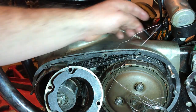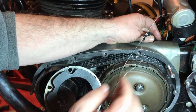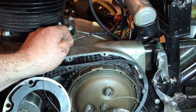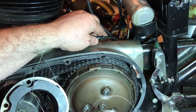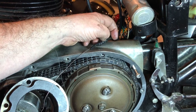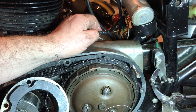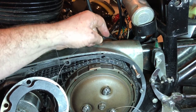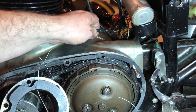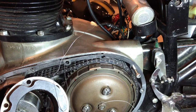What I think I'm going to try and do is push the stator up into the cavity of the case as far as it will go, to allow more wire to be available here at the top. Then I'd like to try and solder the wires on the bike. I didn't want to have to do that, but the benefit is I don't have to pull this wire out and remove the stator. The disadvantage is I'll have to try and do it here while it's on the bike. So I'll try that, and if it fails, it's going to be a little more brute force.